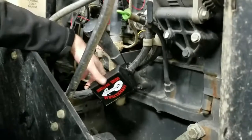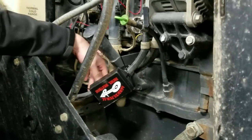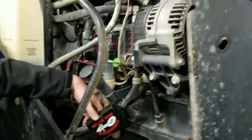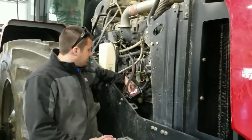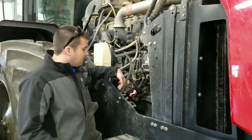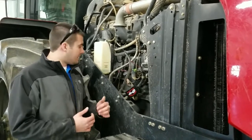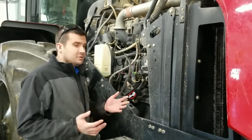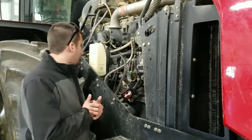As listed in your install instructions, be sure to mount this module in a good secure place. As you can see here, we routed it on the factory wiring harness on the loom — that's a good location. Just make sure it's out of the elements and no weather can get to it. Another tech tip: when mounting these modules, if you can, mount them with the switch facing down towards the ground. That way if any moisture does come in, it cannot seep through the switch or the harness and potentially cause issues. We don't see that very often, but it has happened, so that'll help you eliminate that from happening.